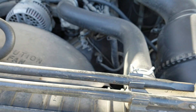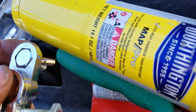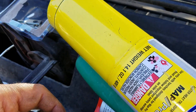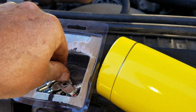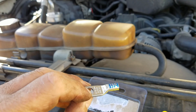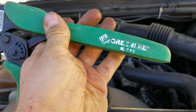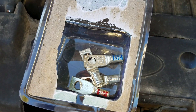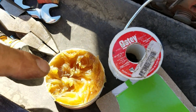I am replacing those with these zinc battery terminals that have a post lug on them. They are brass with a zinc plate, and I am putting new ends on them with these lug connectors — I crimp them. I've got a special $200 tool from Greenlee, but it does do a very good crimp and they are very strong, very good terminals. I am going to crimp the terminal with some flux on the wires.